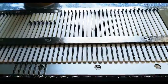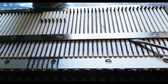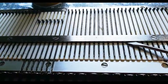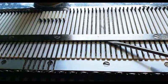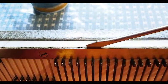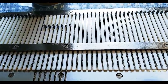Even if your machine is perfectly clean it's liable to be dry. Where I'm running the screwdriver is an area that the cam box cups with its little lip — it comes around the top and the bottom of this rail — so we lubricate that. The same thing is true back here as well; as soon as I did that it did start sliding noticeably more smoothly.